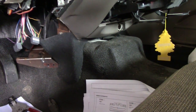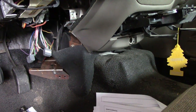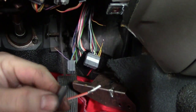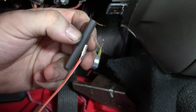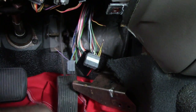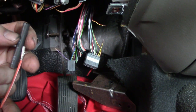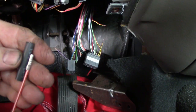It's kind of difficult to get me and all of you guys in here at the same time. First things first - we've got to put heat shrink on our wire. This heat shrink's a little long, so I'll trim it down a little bit. You don't need nowhere near that much. When you're working in close quarters, heat shrink gets kind of bulky down at the connector, so if I can keep it up here a little more, it's just a little more tidy. We'll trim that - it will shrink some, so we don't want to cut it too much.